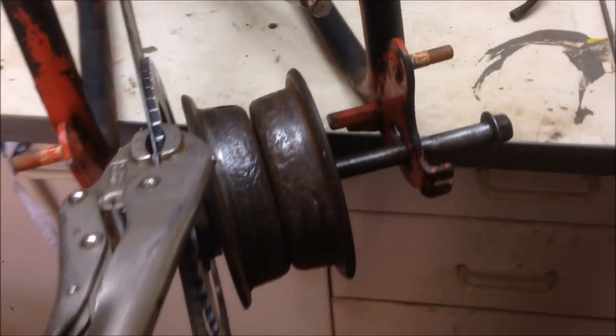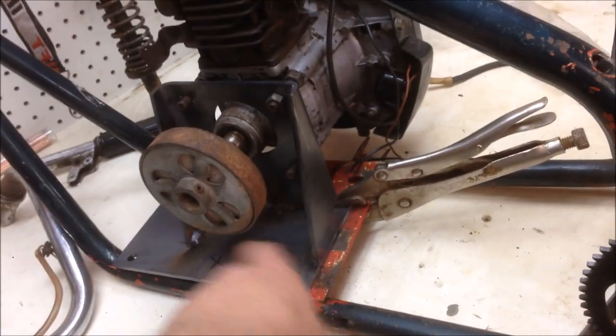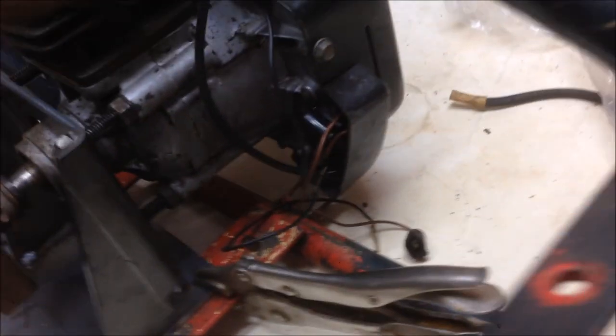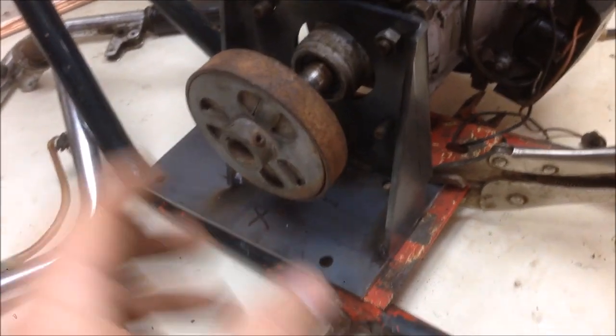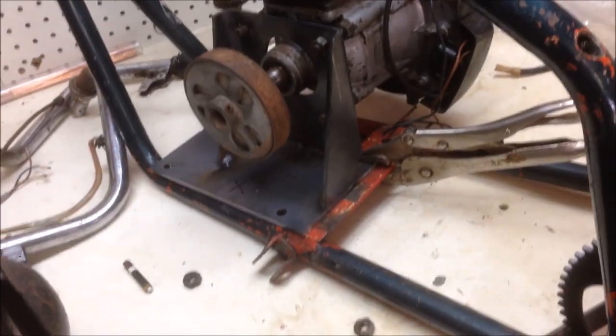I just spun the motor mount around, and we have good alignment that way. Wheel's in the centre, engine's sticking out a bit more, but that is what it is. Now, just one little thing — if you've come to this channel thinking that's not how you restore a minibike, you've got the wrong channel. I need to move that motor mount a lot more forward than where it is. I've spun that around, the holes don't line up. My chain's long enough — I've just checked that. The reason we move it forward is because the foot peg on this particular model is in the middle and it gets in the way of the engine, even without it sticking out that far. I think the best way to do this is to cut this off and then re-weld it so these are in the same spot — just spun around. I'll re-line it up, tack it in place, weld her up. Then we can get into preparation and painting of the frame because there's nothing else I need to modify.